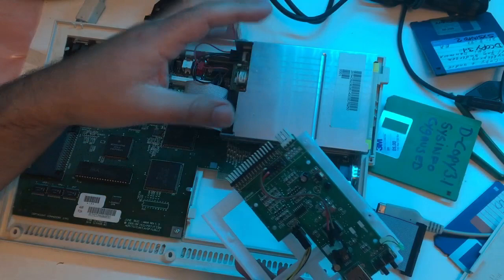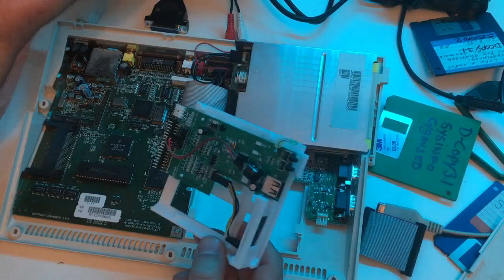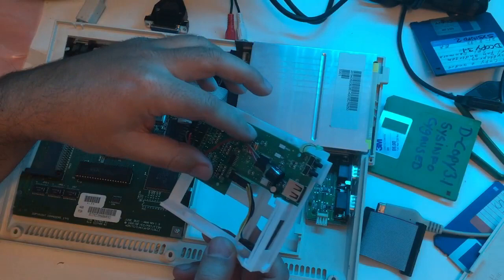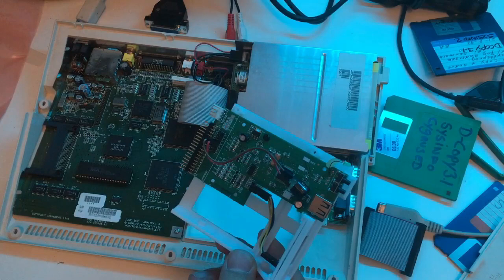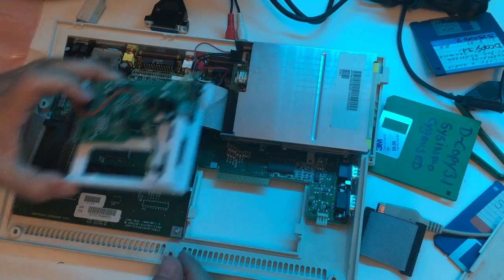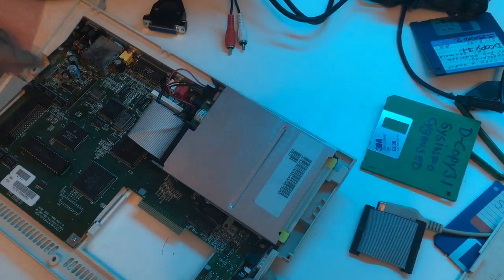On top of that you have a jumper called JB. If you have a speaker, you can install it to that connection and it will emulate Amiga disk loading sounds - it's not that accurate but it's better than nothing. If you want to go with GoTek, do this mod. Sometimes when the Amiga is decrunching and you just get a black screen, you're thinking 'what's going on?' - the sound tells you it's still loading. That's nice.